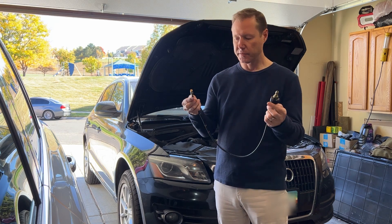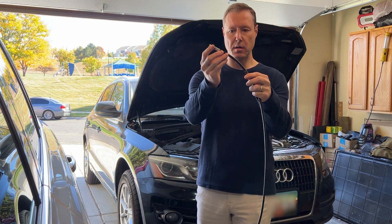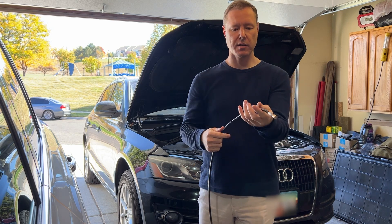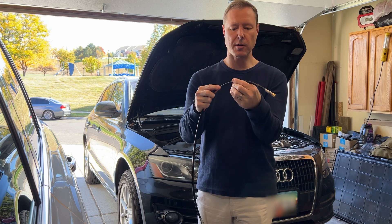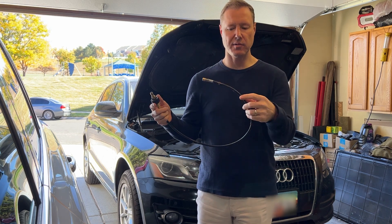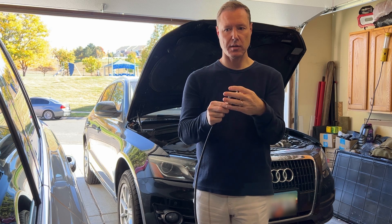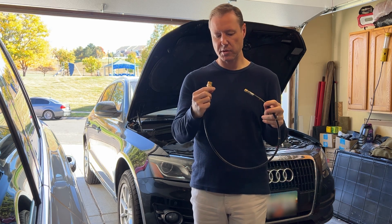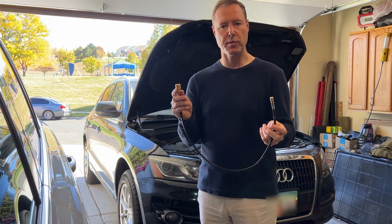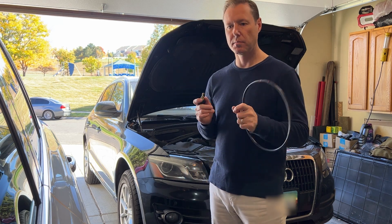This has been a great tool. The only thing I'd comment on is that the rubber bands the Auto House Machine put on to mark the right spots start to slide around when your hands are covered in oil and water — take a paint pen and make a permanent mark instead. I mentioned I had to go find an adapter; I got it at Lowe's. I highly recommend this tool — under $300, which still kind of sucks that you have to do this since Audi designed it this way and it's a flaw in my opinion. But this was way more within reach than getting the Audi tool or taking it to a shop and spending thousands. Thanks for watching — hope this is successful and helpful to you.